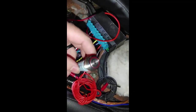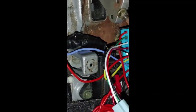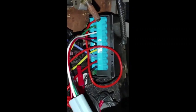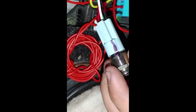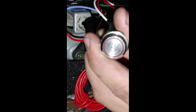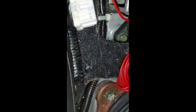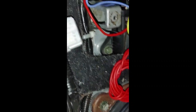I put a bunch of electrical tape around that whole wiring harness, and put the wire harness that I slit back around all the wires that are reconnected to the new ZTech module. We're going to have to pull the top of this light out of its connector so we can drill the hole and mount it inside the center console. We drew a line across the threads and on the side of it so we can plug it back in the correct way. After this, all we have to do is run the red wire and the black wire up to the ECU and put everything back together.